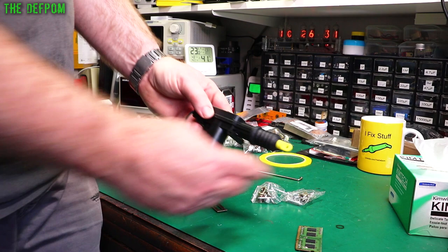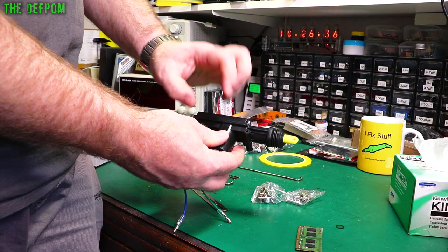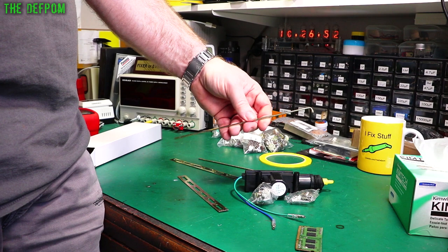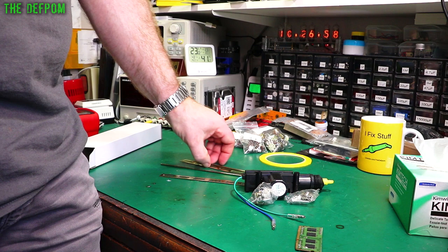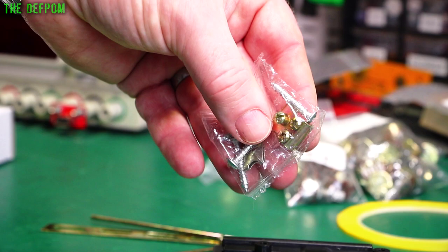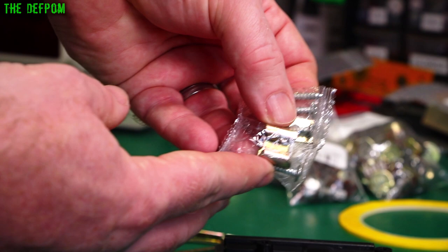On my motorhome I had some similar ones — it didn't actually die, it's still working. But when they go in to lock, it would jam internally, actually latch up, and you couldn't pull it back out easily — you had to force it. A little bit inconvenient when you get locked out. I purchased two so I've got a spare for next time. They come with mechanical hardware kits — the rod, the mounting bracket. Because I already had it all installed, all I had to do was replace the motor. In here we've got a little strap which goes around the bar that links the lock mechanisms together, and then you use one of these bars between the motor and that to move it.